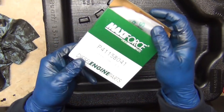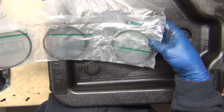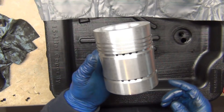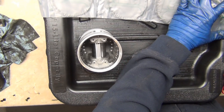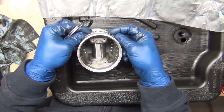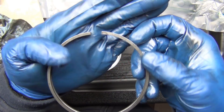I'm using the Maxi Force kit. These pistons have five piston rings, and they've got a really cool packaging system — whoever did this deserves a raise because they did all the piston rings in order, one through five. You've got your compression rings, two follow-up rings, and then an oil return and an oil sweeper ring. The ring has an arrow that points to the front of the engine. The number five ring I do from the bottom — it has a little circle clip in it and a little expanding wire.